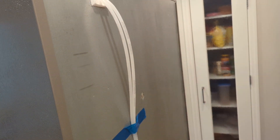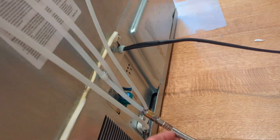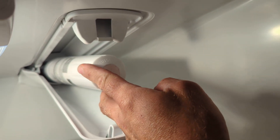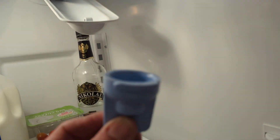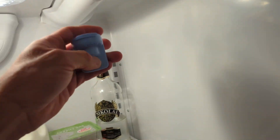Here's how it looks in the back — the water fill container hooks up here, and it was easy to replace by just disconnecting the lines. If you're not sure whether your water filter is causing trouble, you can try running without the filter to see how the water pressure is. Sometimes you can run without it, but most of the time you need to put in a bypass cap, otherwise you won't get any flow at all.